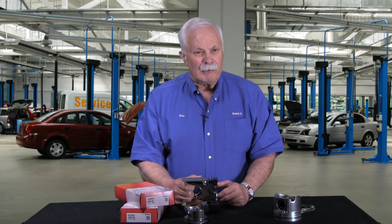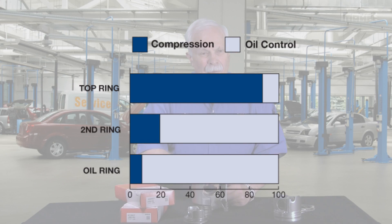That fits very well with most modern engines. As you'll see from the chart I'm holding up here, what we've got in most modern engines is what we refer to as a three-ring piston. We have the top ring — its job is 90% controlling compression. It keeps the gases up in the cylinder and out of the crankcase. The second ring surprises most folks because even though we call it a compression ring, its primary job is to scrape oil off the cylinder wall.